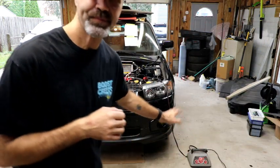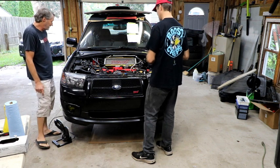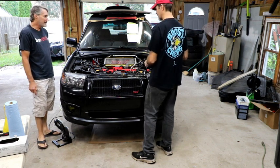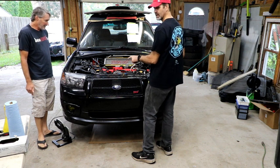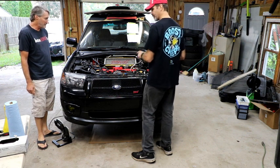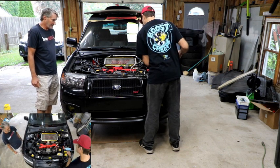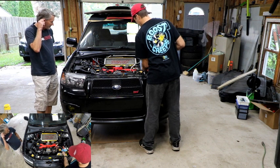Right now I've got a battery charger hooked up to it on the floor so I can make sure the battery's up. It has been sitting for close to a month doing this rebuild, but finally going to get to it. I've loaded the new tune. I have five quarts of oil in there. I've brought the coolant up but it needs to be bled yet. I'm going to check the oil again real quick and it's just above the full mark, which I'd expect since it hasn't been circulated.